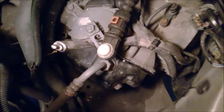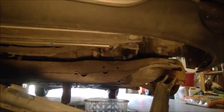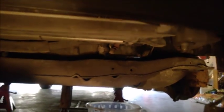Okay, so probably as you can see, it starts to detach. I had to hammer it a little bit to slide it in there in between at some places. Then at some point, you are just prying a little bit and it's detaching. At this moment, I'll try to catch the fluid so I don't make a mess on the floor. Again, see how much the subframe is lowered. I'm not sure if you can see it. It's not in place, you can see it. It's pretty low, and you need to lower it this much in order to remove the cover from there.